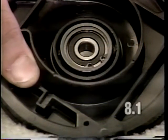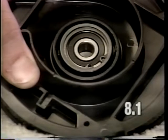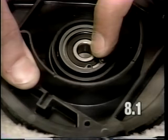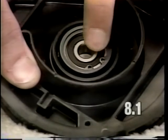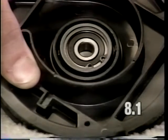If you are experiencing motor bearing noise, one or both of the bearings may need to be replaced. One indication for a bad bearing would be roughness felt. Spin the inner race of the front bearing with your finger to feel for roughness or sticking. Replacement of the front bearing is described in Section 6.